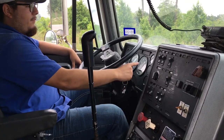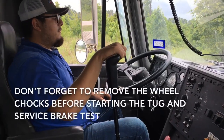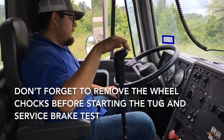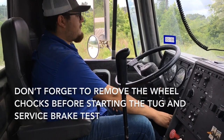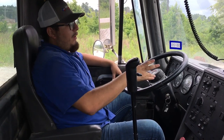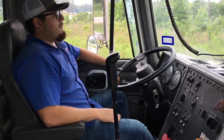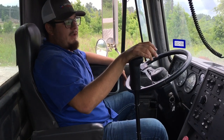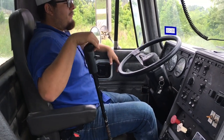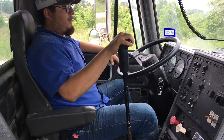My knobs popped out at about 40 PSI and I have now completed my air brake test. Now I will check my service brakes — my tractor and trailer brakes if I had one — and turn the truck on for that. Normally when you finish your air brake test you have no air on the truck, so just build it back up. For Class B, you're just going to check the tractor brakes. With the brakes applied, put the truck in low gear and try to move forward. That confirms your brakes are working properly.